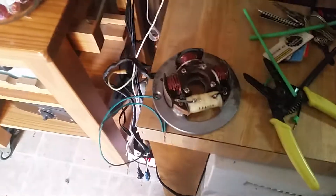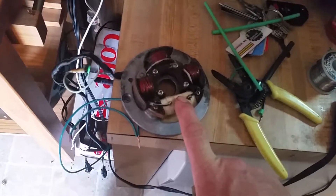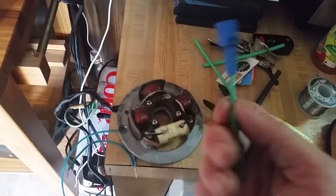Hey YouTube, this is Kevin. A lot of people use butt connectors to attach wires, but I solder all my wires. I'm adapting an electronic ignition to a points ignition system to get rid of the points, and I made up this wire right here. You can see I soldered it. I want to teach you a little bit about soldering — it's actually the best type of connector. It's solid.